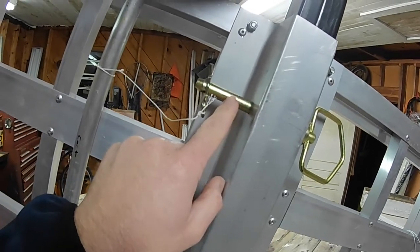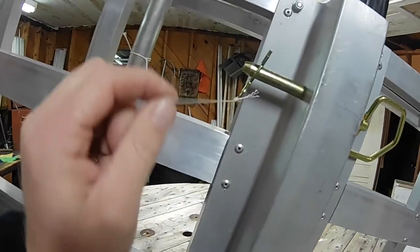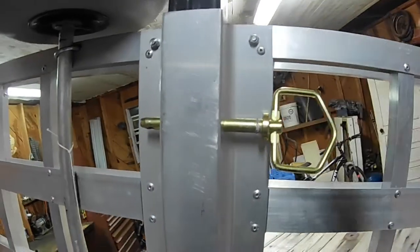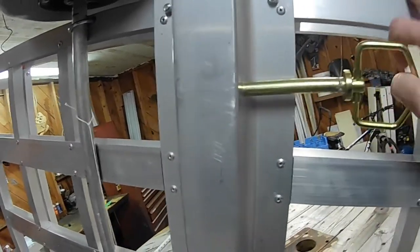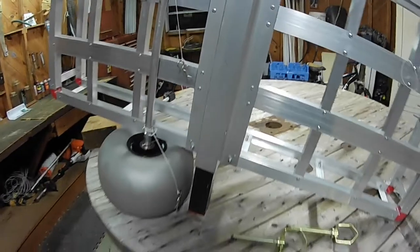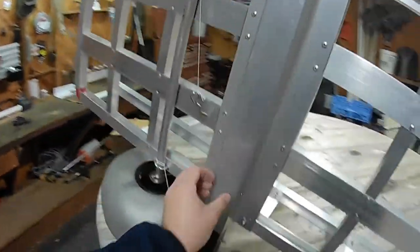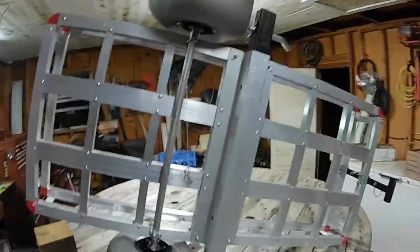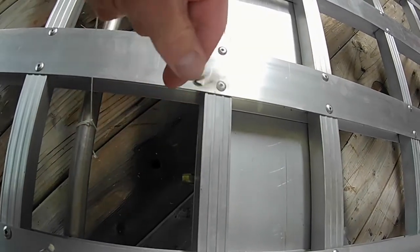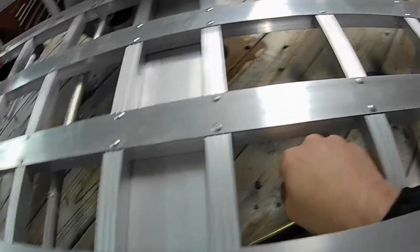These are half-inch hitch pins I got from Tractor Supply — they come with keys. I put a little piece of rope on them so my wife doesn't lose a pin. You just remove the pin and the hitch will slide out. The hitch is removable. Not all of the hitch packers I've seen come with this aluminum tube casing, so mine is unique in that way. The pins are long enough that you can see them from the top, reach in, and pull the pins out or install them.